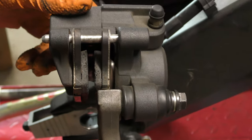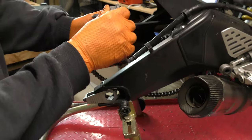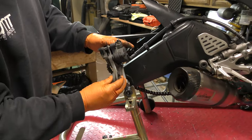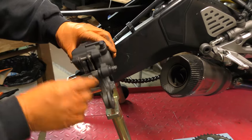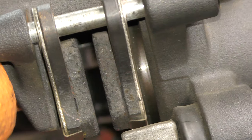There's tons of rear pad left, so we're fine there. In terms of the piston inside, it's fairly clean down in that gap, but could do with a toothbrush and a little work later when we put it all back together.